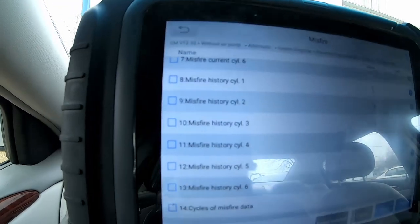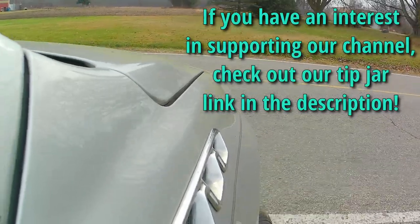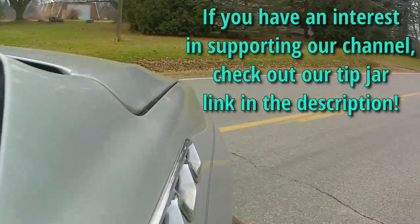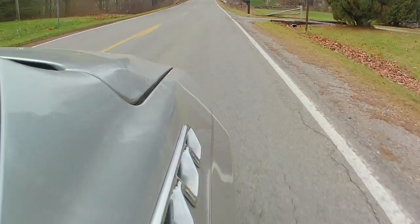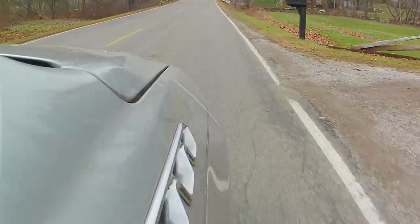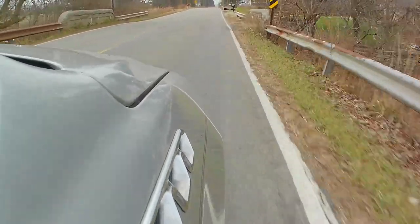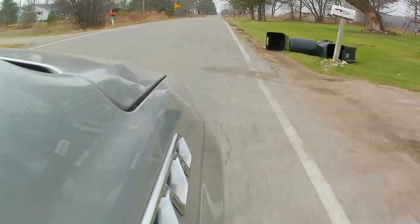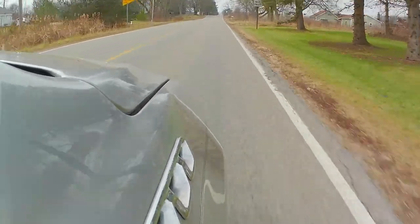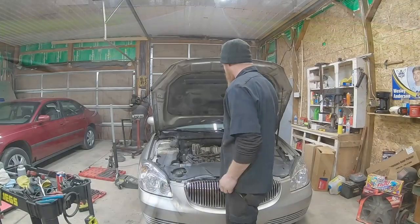So that's good — you can see those values there. We're good now. Fired it up, it runs good. Remember, we swapped this coil — no matter what coil we put on top of the ignition control module, no spark at all, no fire. We went ahead and replaced the spark plugs and wires — they were original equipment with 147,000 miles on them, so it was a good opportunity to change them while doing other ignition components. Sometimes a bad plug wire or a bad plug could ruin the module. So all that's done.